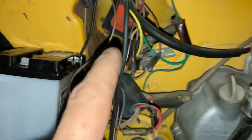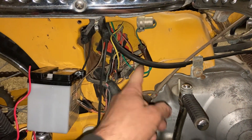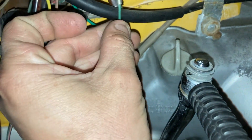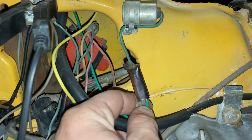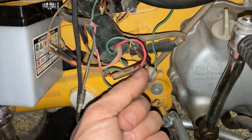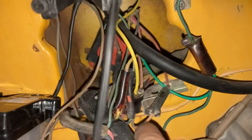The other connection I want to show you is your coil, because I couldn't find that anywhere. If you order a coil online off eBay or Amazon, you're going to get one like mine — it came with a green wire and a yellow wire. The green wire was pretty obvious because this little wire was coming out of the condenser. Your condenser is supposed to split to two, so if it doesn't split, your wiring's cut up. This green wire runs there with a little extension, similar to Honda ATCs, and then the other green wire splits off and runs to your coil.